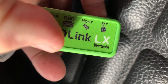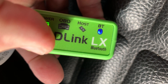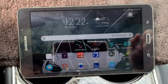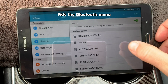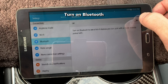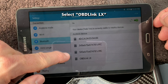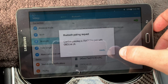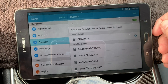Press the button on the lower left of the OBD-Link LX and you will see the BT light on the right start blinking rapidly. Within two minutes, you need to do the following steps. On your device, press the settings button, pick the Bluetooth menu, and turn on Bluetooth. Sometimes if it's already on you have to reset it to see new devices. You should see OBD-Link LX — select it and press OK to pair the device. It is now connected.